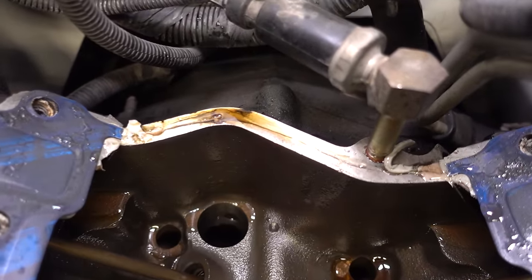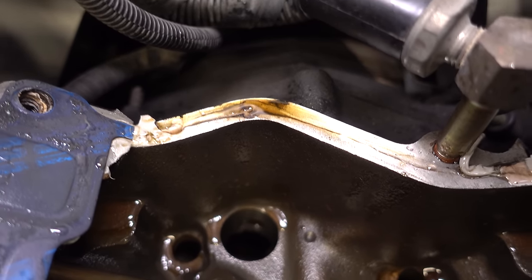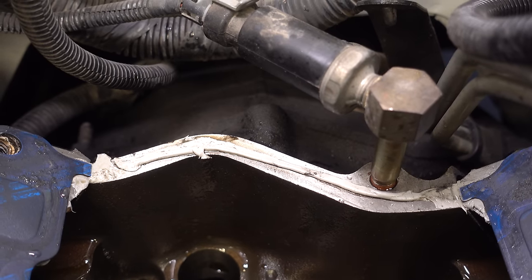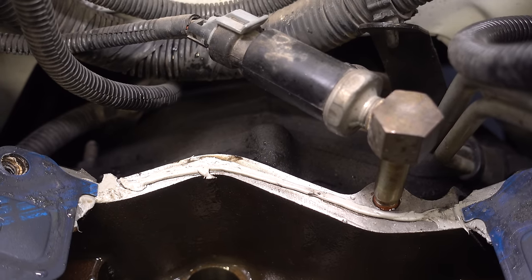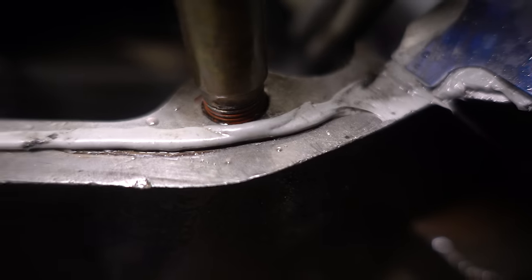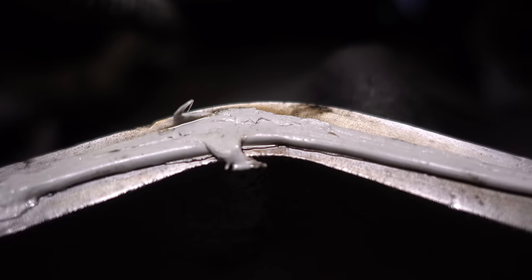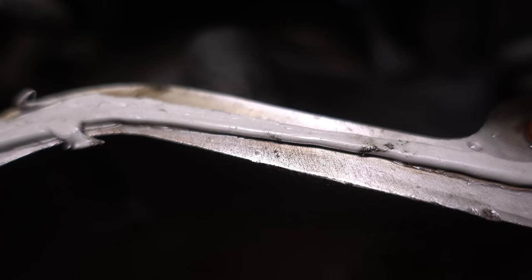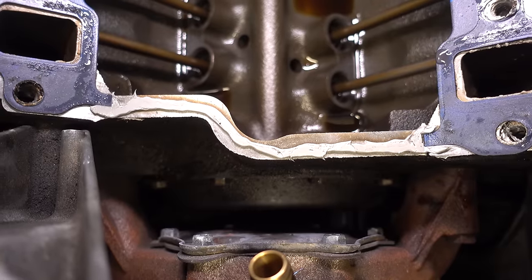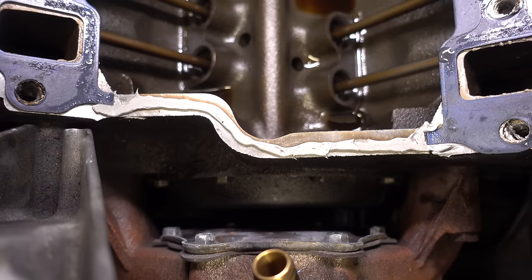Now let's look at the culprit — the whole reason why I'm redoing this job. Look at that oil on that surface right there. That was pouring down the back of my engine onto my exhaust manifolds and other parts. Luckily, that gasket maker is pretty tough, so it was still in one piece, and I put it back on pretty close to exactly where it was when I installed it. Right away I can see a major problem — I simply didn't use enough. You can see areas like this right here that didn't even get smashed down. If we look at the front side of the engine, I did apply a little bit more than I did on the rear. And for that reason, the front side had just enough — I don't think the front side was actually leaking. I think the culprit was the rear side.